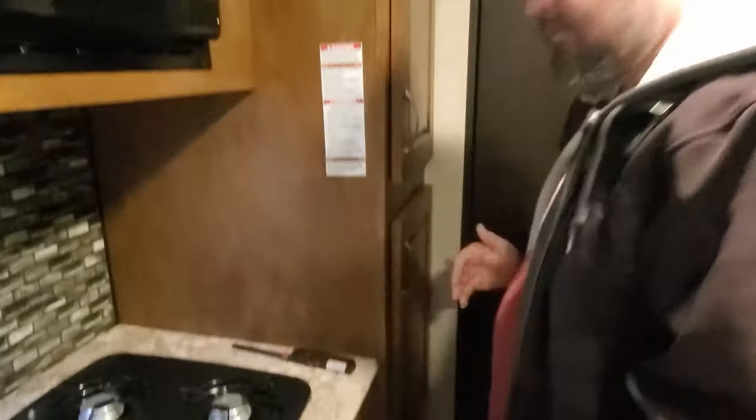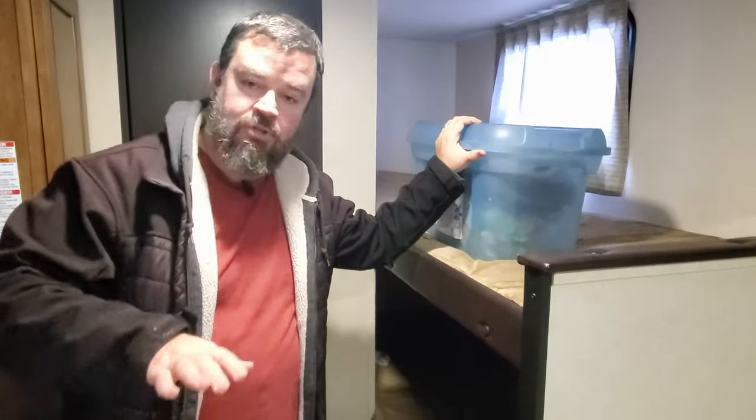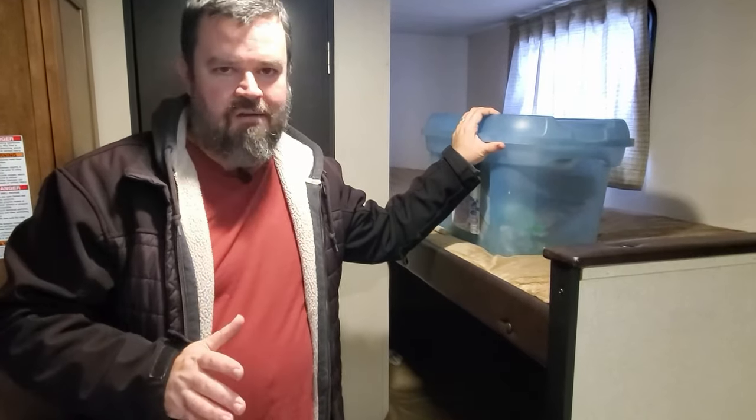Back here near the rear of the camper I have cast iron pots and pans in the pantry — I've kept them situated nice and low for stability. If you're bringing totes and bins, really recommend putting them on the floor. I know that's frustrating when floor space is limited, especially with slide-outs in for travel, but it's about being safe and getting to the campground in one piece. Load things as low to the floor as possible and keep as much as you can to the front of the axle — roughly that 60-40 split: 60 percent axle-forward, 40 percent further back.